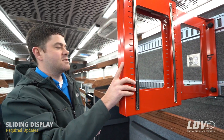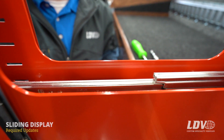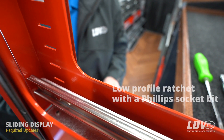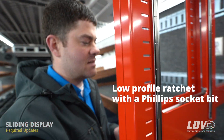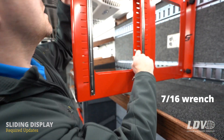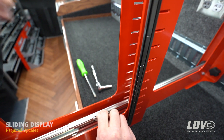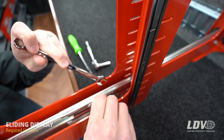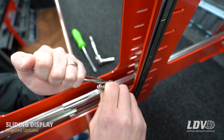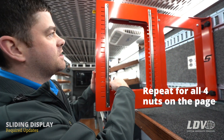With the slide-out pages, there are also four nuts on the slide itself, but these are on non-painted surfaces, so we just want to ensure these ones are tight. What we're gonna do now is grab a low-profile socket, ratcheting screwdriver socket, and then a 7/16 wrench. You might have to close the display a little bit to get the back ones. Get the wrench socket and the wrench on there and just ensure these ones are tight. Then do the same thing with the other three.